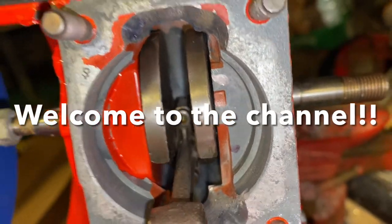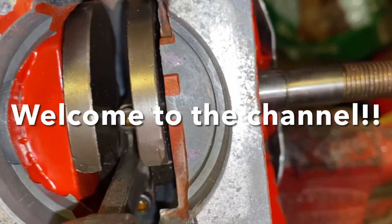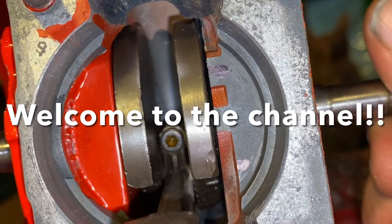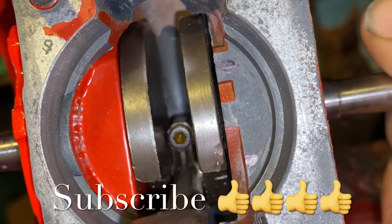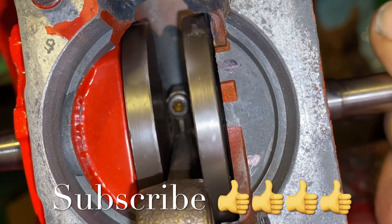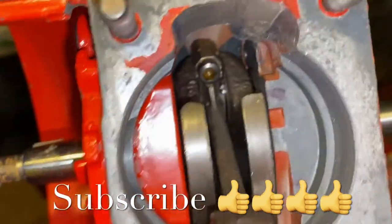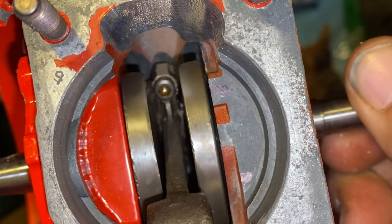You can see my two black marks — I have them set up. Let me zoom in a little bit. I've got a mark up here and a mark here, lined up with this point on the crankshaft. From there to there is what I'm talking about — this is the amount of time in the rotation of the crankshaft that fuel is transferring above the piston. Take note of the position of the crankshaft — it's just that little bit traveling along the bottom.